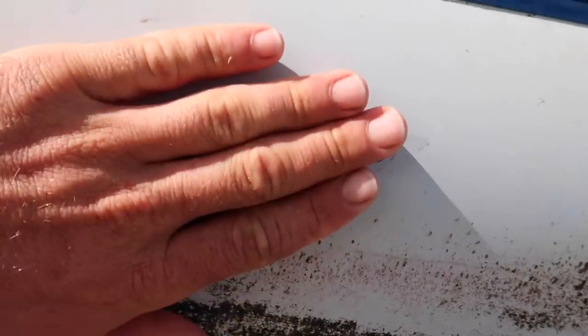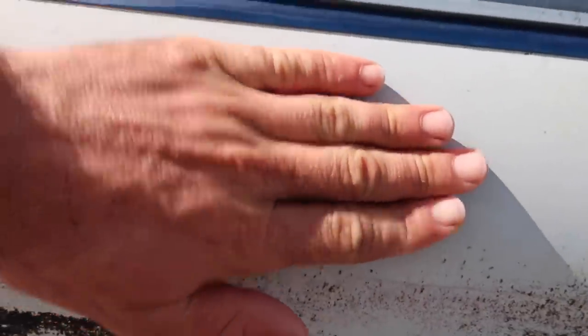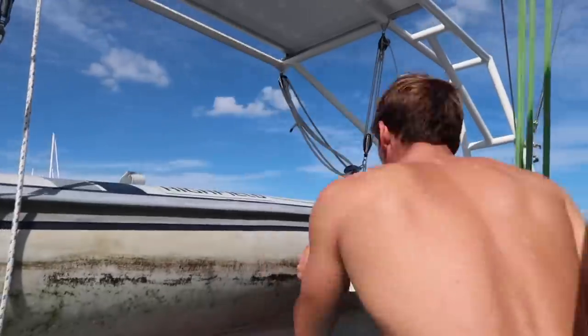And I've read multiple sources where some say to leave the tube inflated, some say to deflate the tube. I don't know, we're gonna leave it inflated and try it out, because like I said, it's a really slow leak, so I don't think there's gonna be enough pressure to bubble up the patch or anything, but we'll see how it goes. Trying to deflate it and then apply a patch, there's no backing or anything. I'd have to flip it upside down on the trampoline or something, but this is way easier, so hopefully it works.